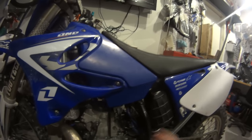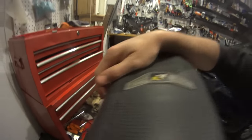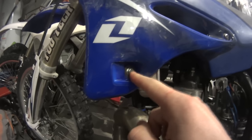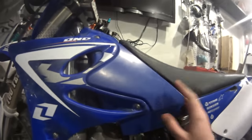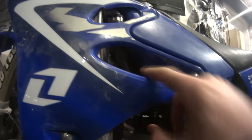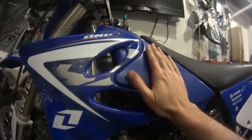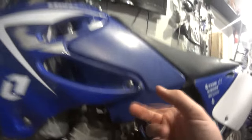To take it apart it's actually very, very simple. You take the seat down - there are two bolts over here, one over here and one on this side. Then after you take the seat down you have to take the gas tank down. There are two bolts, one over here, one on the other side. You have to remove these so the plastics will come off the radiators. And then there are two bolts inside here. So with a little socket wrench you'll be able to access them from each side. That's the only thing that holds this tank to the frame. And then disconnect it from the carburetor and the tank comes out.